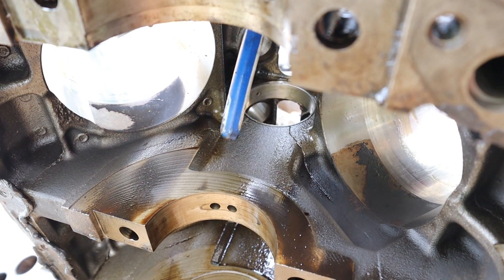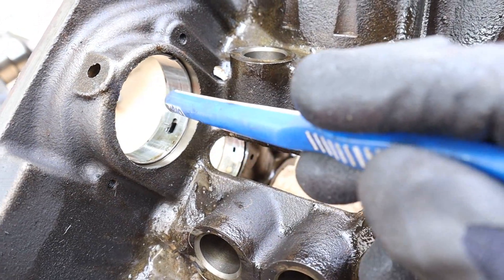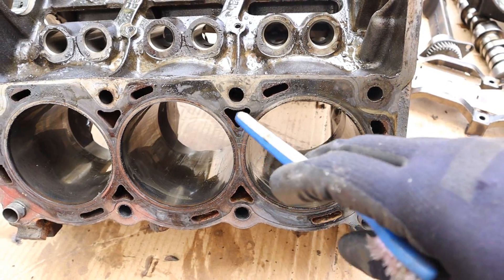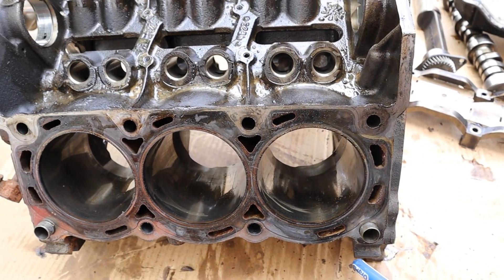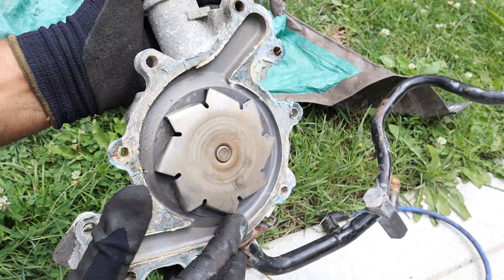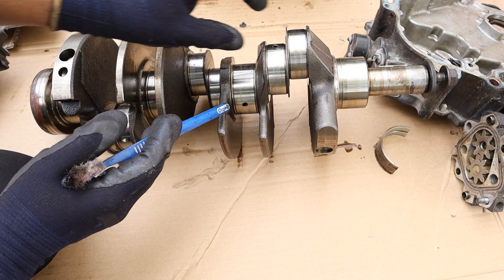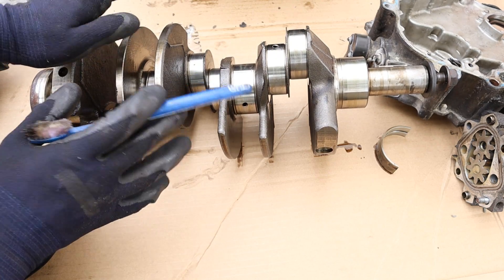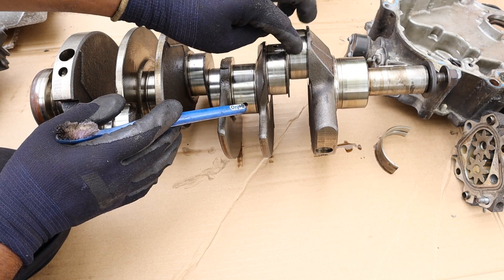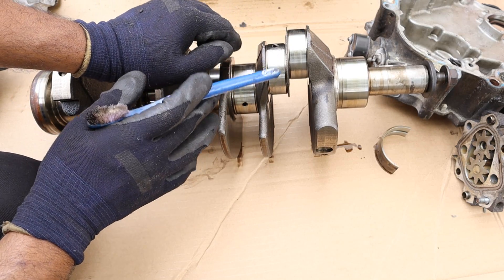While the camshaft is being lubricated up above, there are also taps drilled into the crankshaft to lubricate it and the connecting rod bearings. Also stealing oil from the camshaft is the balance shaft bearing on this side and on the back of the block. There are a lot of freeze plugs back there. This engine does use a semi-closed block design which is really good because you can pump a lot of power through it, although it's not going to be as good for cooling because you don't have a full water jacket running all the way around that interfaces with the head. Check out the fins on the back of this water pump. Looking at the crankshaft, as mentioned before you do have this offset because this is a 90 degree V6 engine. 90 degrees are mostly used in V8s because that's the way the power will balance. Because of this offset it's really thin between these two connecting rods — I feel like if there was a catastrophic failure it would probably occur right there.